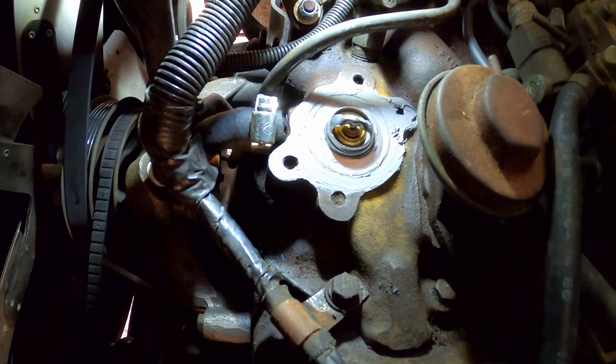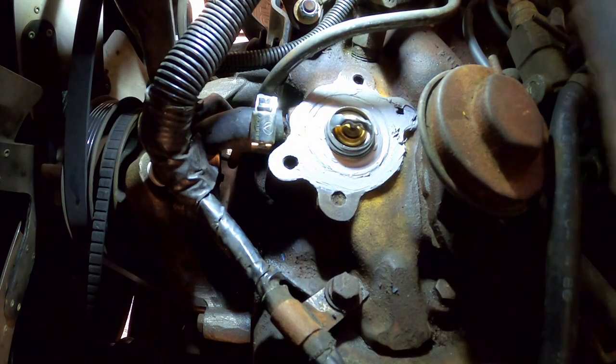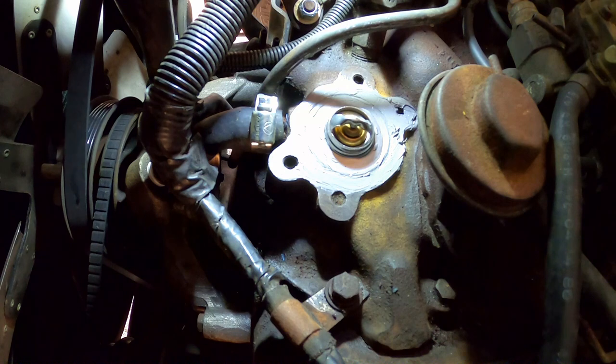So I guess we're ready for the new gasket. Let's get that gasket out here. Okay, it's a number 35062. That's what the big block Chevy takes. What does it say on there? It says AMC 4 151 engine from 1980 to 1983, GM product 4 V6 and V8 from 1935 to 1995. That one gasket covers a lot of different vehicles, doesn't it? It's okay, we just needed that last part. The Chevrolet V8, 1935 to 1995. We got 1987 product here.